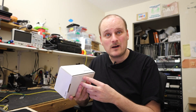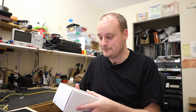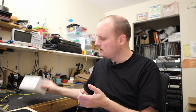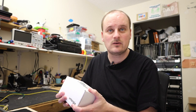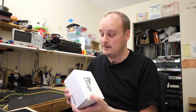It's actually a really small box — it's tiny. A lot of you would ask what it's actually good for. Well, say you have a corporation or a business with a bunch of small off-site branches. You'd buy something like a Z6 — a larger appliance that can handle more bandwidth and more VPN connections — and then you'd send these little boxes out to each location to do VPN tunnels back to head office for applications, printing, and so on.